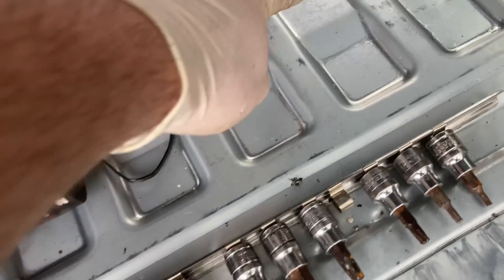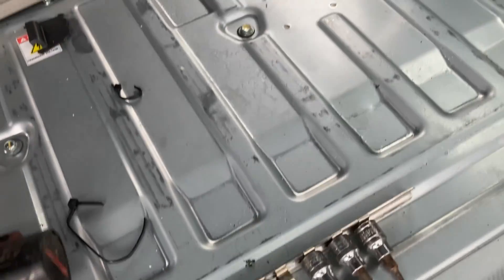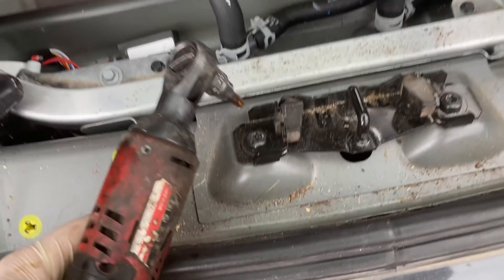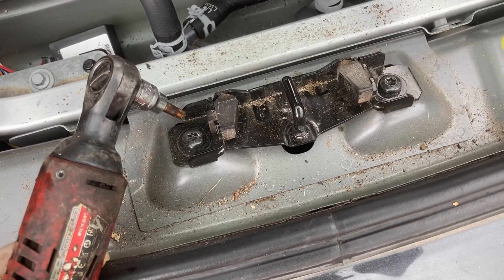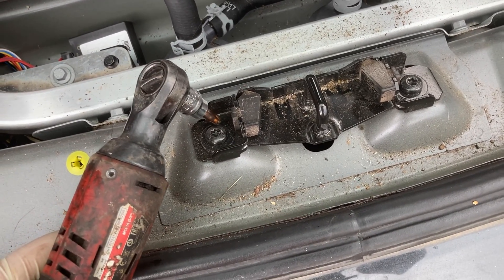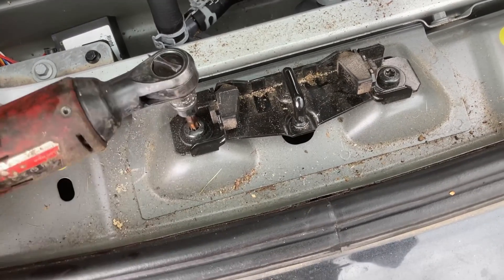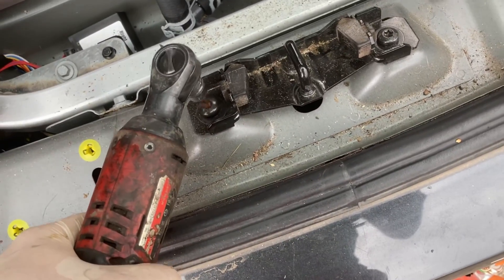I spilled a tiny tiny little bit — you can see here — virtually nothing. But very importantly, do not forget to disconnect this. Both batteries are disconnected — the high voltage battery is disabled and the 12 volt battery is disabled. If you lock the boot you won't be able to open it, same with all the other doors, so give yourself a way out.